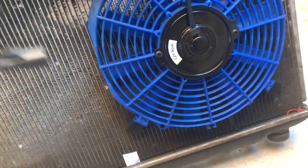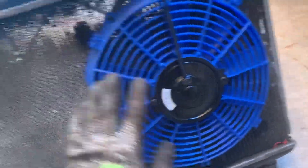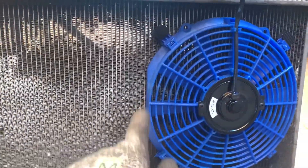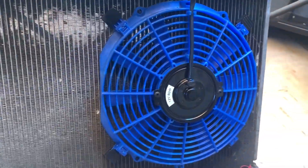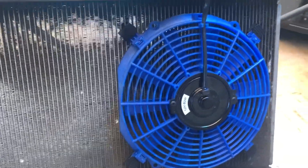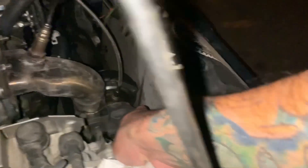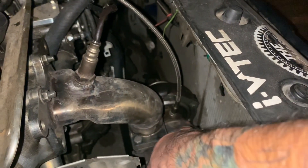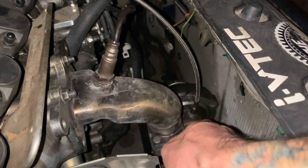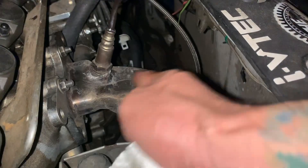Also, I went ahead and changed the polarity on the fan, so instead of spinning counterclockwise it spins clockwise and pushes air through. I'm going to mount it to the car, put the coolant in, and take it for a spin — hopefully that shows me it's cooling and I don't have to go back and swap the polarity or mess with anything else. I probably have like maybe an inch gap from the turbo to the radiator. Should be fine, but I don't know if after a couple pulls it might start dinging or dent the radiator. So yeah, probably need to cut here too and just make it shorter.